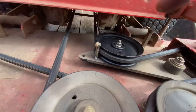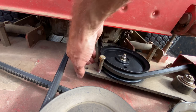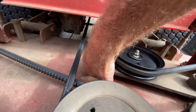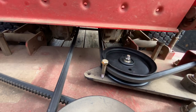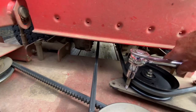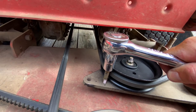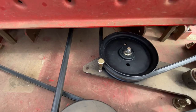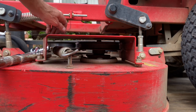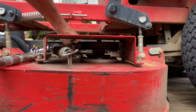The way this process works, you want to get the top of this bolt head higher than the pulley. Once you've got it where you want it, go underneath and loosen that nut, tighten it on there tight. Once it's tightened like that and you've got it where you want, instead of tightening the bolt you act like you're loosening it until you get it snug, then lock that bottom nut on there tight. Last thing you want to check is make sure your belt is on this pulley right here. Take your hand and help it around - everything's on, everything's connected, so we're good.